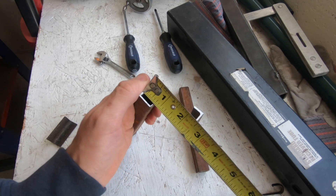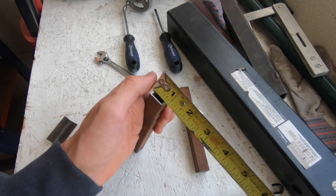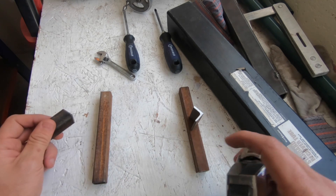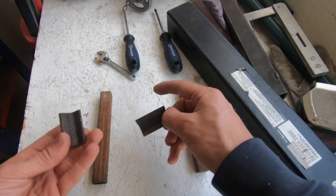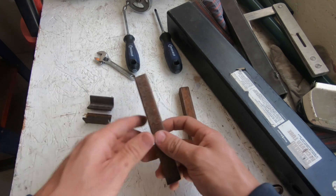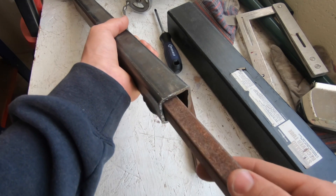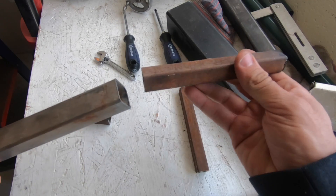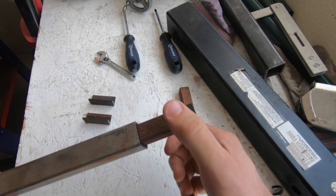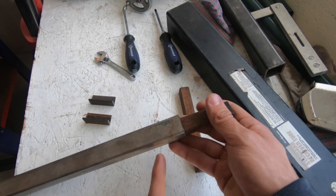The size of the square tubing for the main rail is three-quarters inch. The tubing for the indicators that slide over it is one inch. Whatever you get, it doesn't matter if you use round or square — what you want is a decent fit. For example, inch and a half would be entirely too big because we need to put a set screw. The one inch and three-quarter slide together perfectly, and it's okay if they've got a little slop because the set screw will snug that up.